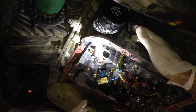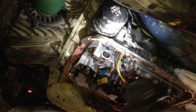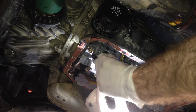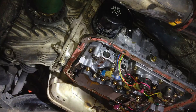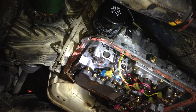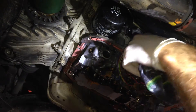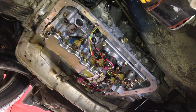Click — push it down nice and firm. You can see the excess that's come out, so there's definitely quite a bit around it. Make sure you reconnect any plugs you've undone — the solenoids. Now clean up the outside and wipe any excess off so it doesn't look too ugly. It's grey anyway on the silver gearbox and it's going to get dirty. Make sure you tighten the sump plug back up and clean everything out.